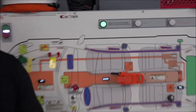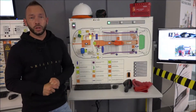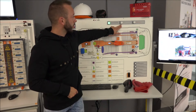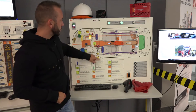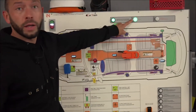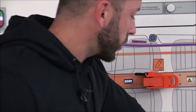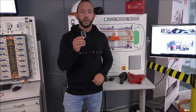When we come to the car, we first make sure the high voltage system is really shut down and the ready mode is not activated. If I go to the brake and press engine start, you would see the high voltage powering up and ready mode activating. So first we shut down the ready mode, and then we have to make sure to get rid of the smart key.